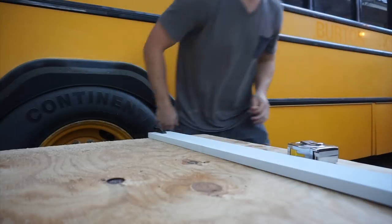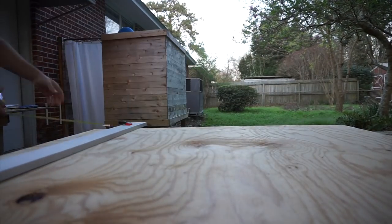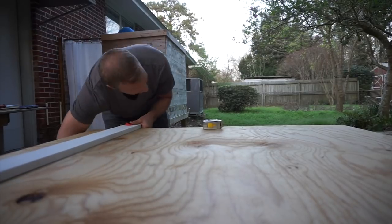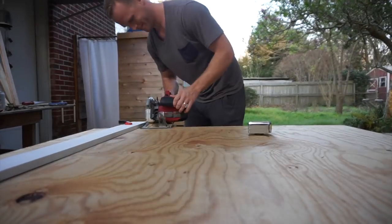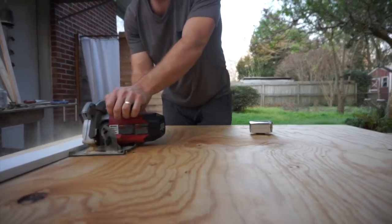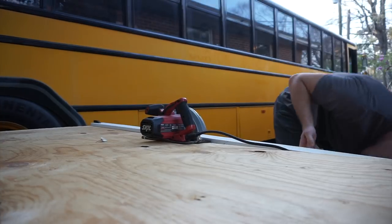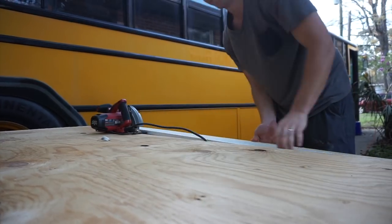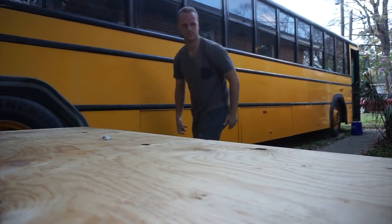What we're making is called a floating subfloor. We're basically making an insulation and plywood sandwich with glue instead of framework or screws. This allows us to prevent thermal breaks in our insulation. If you're willing to sacrifice more headspace in your bus conversion, you should consider buying a much thicker foam. For more tips about how to insulate your bus, check out buslandia.net, which is linked to in the description.